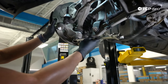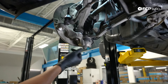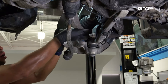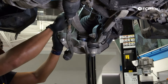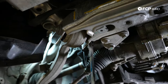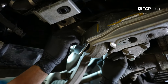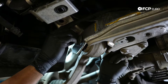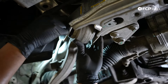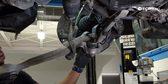I'm checking to see if the joint is spinning while I'm removing the nut — looks like it's staying in place. If you did need to counter hold it, that's a T-45. This arm is all the way loose. It's a very tight space to work between the stabilizer bar link and the axle. I'm going to remove the bolts over here — that should give me enough clearance to remove that control arm. Counter holding: this one is 21 mil and this is an E-20. So we have a nut and a fairly substantial washer on the backside, then at the front a long bolt and another washer. We've dropped it out of the body and that gave us enough room to just wedge the control arm right out.